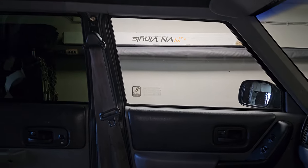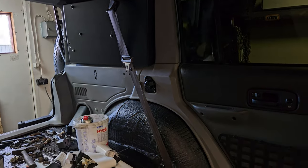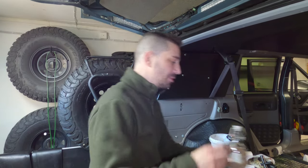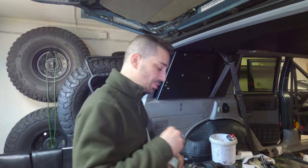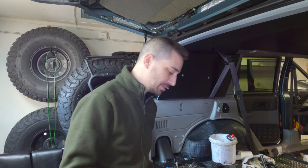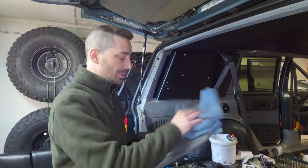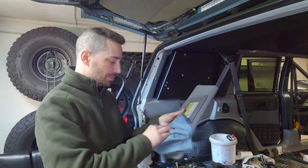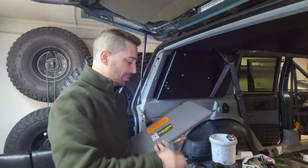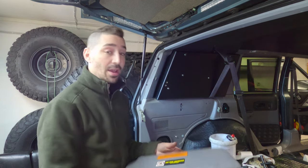This is a very time-consuming job. I'm getting through it — things are looking better. A few little cracks and things here and there, but this interior is super brittle in some parts. To clean up some of these fabric pieces, I'm actually using thinners. Not the best stuff you can use, but you just want to go easy with it — it will literally clean anything. Not paint thinners, but kind of an industrial thinners for cleaning. I'm pretty much doing all my interior with this as I'm reassembling it, which is essentially why it's taking so much time. But if you do use thinners, just know that if you brush it over these painted parts, these stickers and things, they're going to vanish.